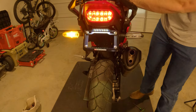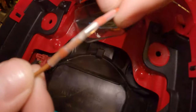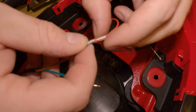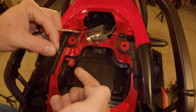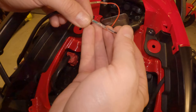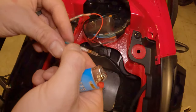Let's test the tag light — brown is positive, and there we go. This is what it should look like when you're done. Do one side at a time, make sure your wires are touching together, then melt the solder ball in the middle. Slide one side in, make sure the copper is in the solder ball like that, then slide the negative in — green and black are negative. Make sure both are in the solder ball, melt one end, then melt the other end.